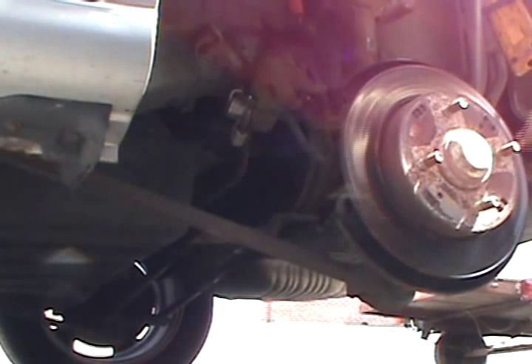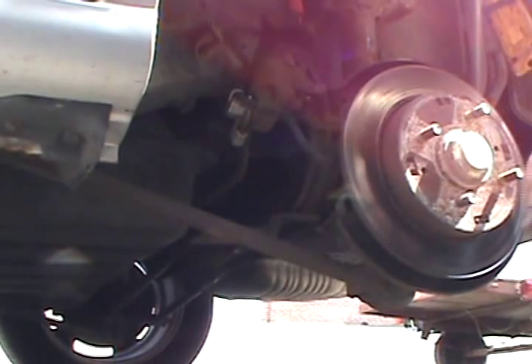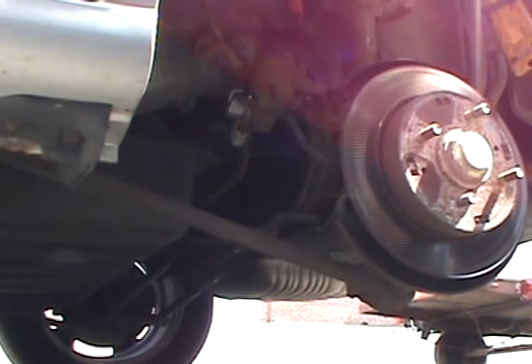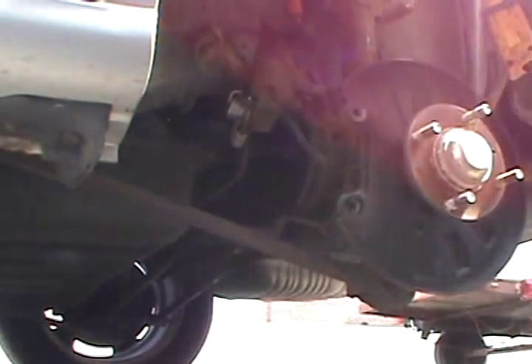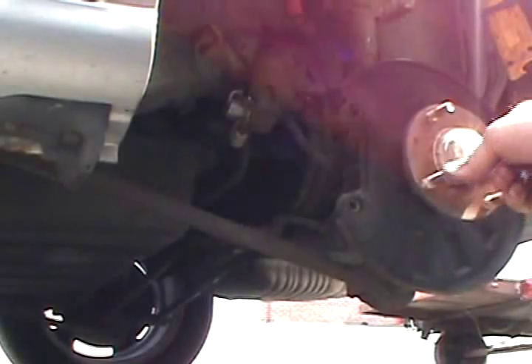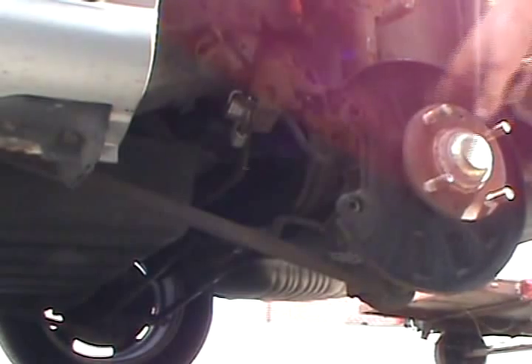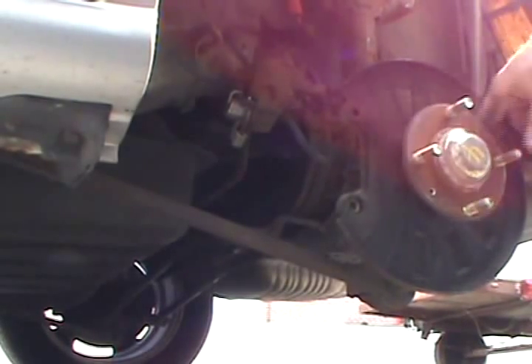These rotors have one jacking hole right here. A lot of times they're so rough you can't get into them. I've got new rotors so I'm not too worried about these ones. I'm going to try tapping them in between the studs — that's all it takes. If you don't have good aim, you can start a couple of lug nuts on it prior to hitting it. You also want to make sure all this rust is cleaned out — anything left over back there is going to throw your rotor out of balance and could give you a bad pulsation.